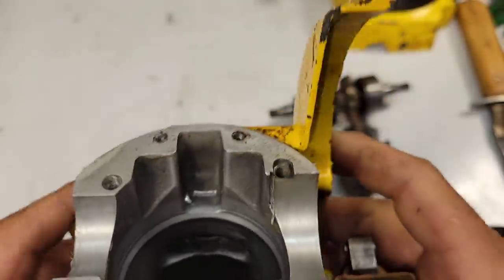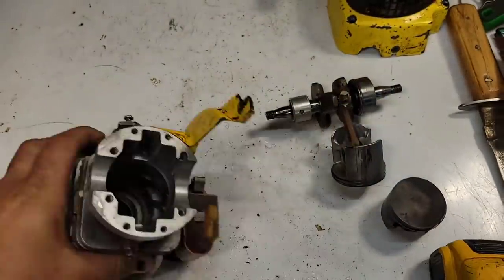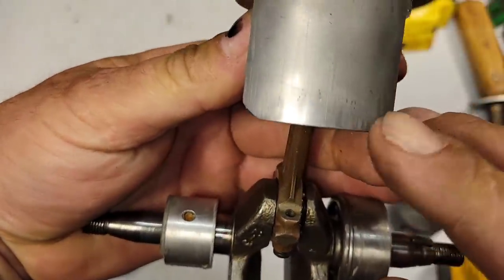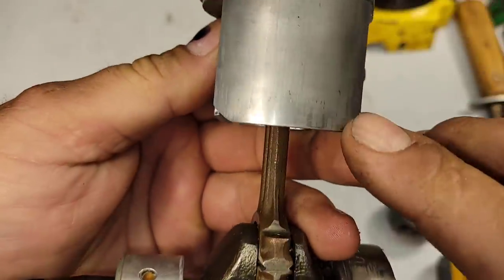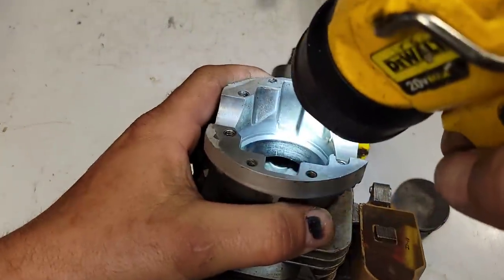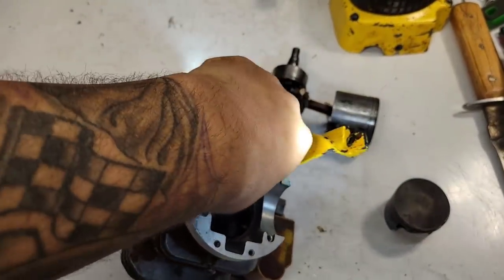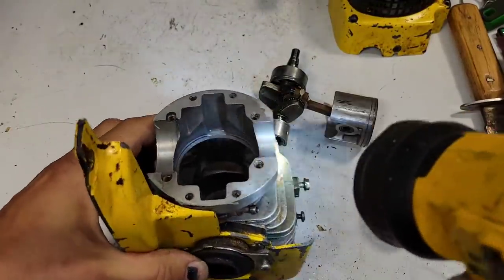This thing ran a substantially higher RPM in the cut than stock. Okay, you're putting more load on here. That's putting more thrust on this piston in the cylinder, and it'll start to polish that. But I don't see any chipped plating. There's no sharp spots. Everything feels A-okay. Now, let's look at the exhaust side.